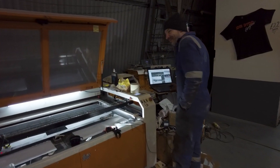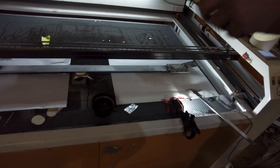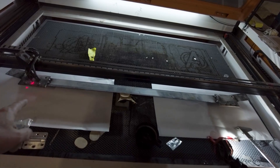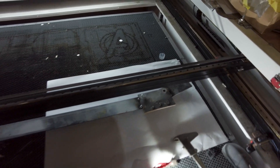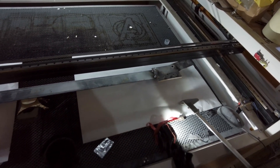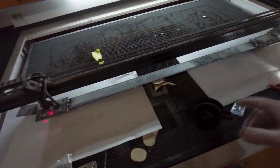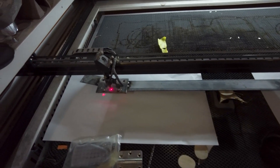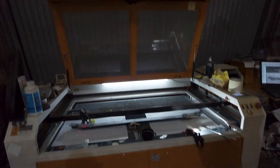I'm going to head over here and show you what Jonathan's up to - it's top secret. He's measuring the positions of the hinges to make a new bar. This is the bar that came with the kit - it was just a bit of angle iron bent into shape, and then you get two metal plates that you drill your own holes in and bolt to the frame. We're going to make this bar as part of the kit as well, but it'll have the brackets and holes already positioned. He's used a camera in the top of the laser so it's photographed the piece and done the positions of the holes and an outline.